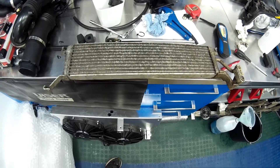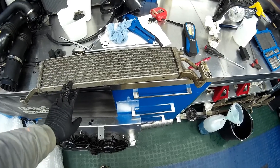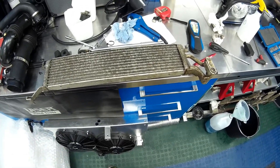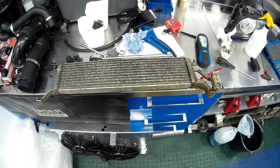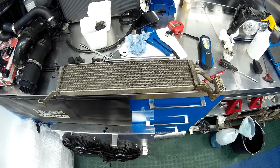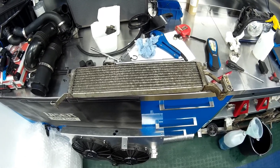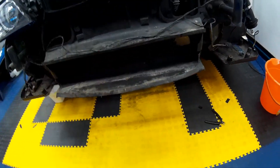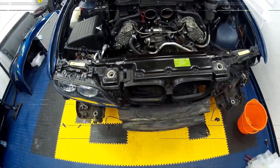This is a used part and I've flushed it out with petrol to remove any traces of previous fluid. It came out pretty gunky so I carried on until it ran clean, using about three or four litres of petrol in total. This is going to be mounted down in the air dam so it gets primary airflow through the lower grille of the front bumper.